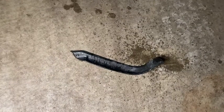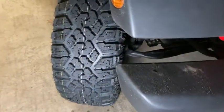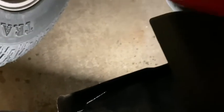Here's the carcass from the driver's side. And you can see the angle there that I'm coming across as I cut for this passenger side. I would say if you're gonna do this, crank your wheel just like this, give you a lot of space so you can see there's no brake lines or anything in the way. So you should have no issue coming through. This gives you an idea of the angle that I came across as I was doing it there, right across that line.